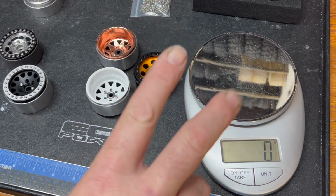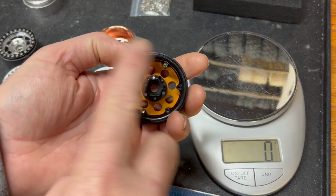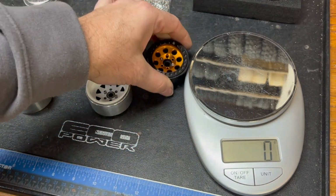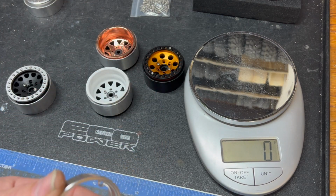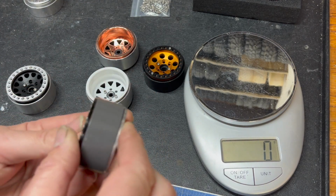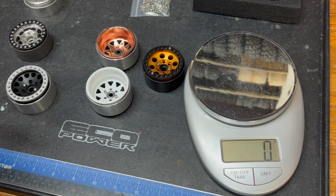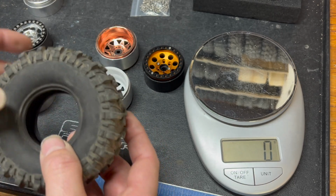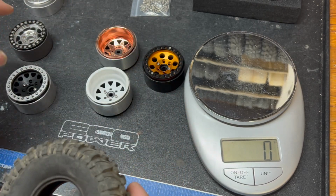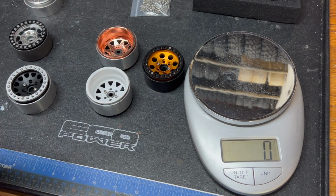Well, two things. Price, and then behind that, I want 6 bolts to mount the back. I do not favor the 5-bolt ring. Especially, you will see 5-bolt rings a lot on the narrower beadlock ring, and that makes it really difficult to mount a tire, particularly if you have a big sidewall guy, a big mushy guy. Trying to mush this down onto that with 5 bolts is not easy. It's far easier to mount any of these 6-bolt guys.